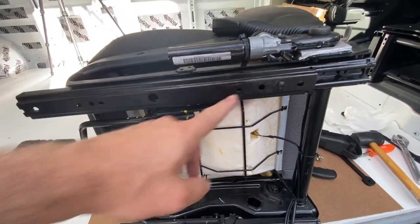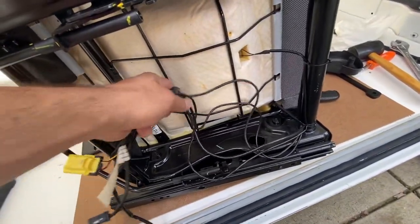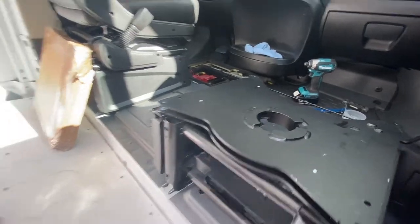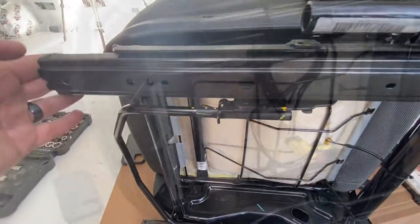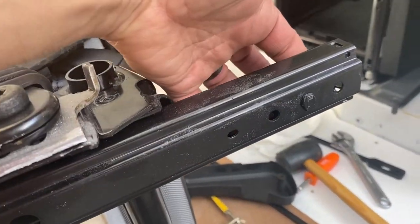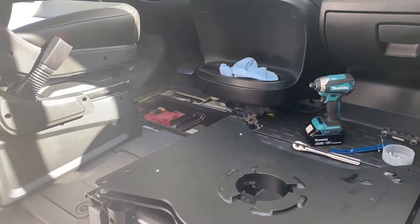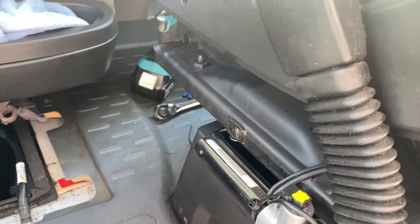Now that we've cut this piece, the next step is to get the seat back on top of the swivel. I'm going to take these wires and stuff them in here to hold them, then lift the seat and guide the wires through the hole, line it up, and start screwing it down. These rails move independently — I pushed the bar up to loosen them and pushed both rails all the way back to expose the back two screws. Once I put it on I can do these two back screws, then move it back and get the forward ones. I've lined up the four back holes and we're going to screw them in.